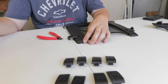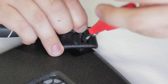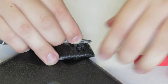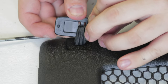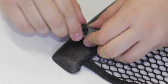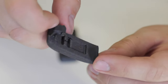Now let's go ahead and install one. The tools you're going to need is a simple list — just something to cut with and a screwdriver. You're going to start by wedging your screwdriver between the stretching material and putting it off to the side. Then go ahead and cut off the factory clip. You don't have to be precise — just cut it on the side with whatever you've got. Go ahead and remove the factory clip, make sure you don't cut the stretchy material, and you can put on the new clip. It takes a little bit of finesse with the screwdriver to get it in, but after a minute or so it should slide through.